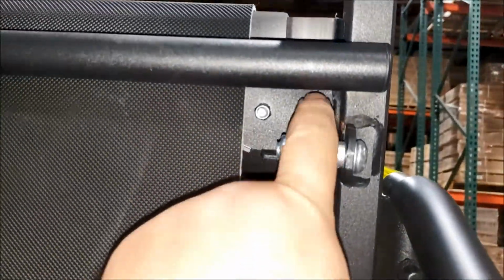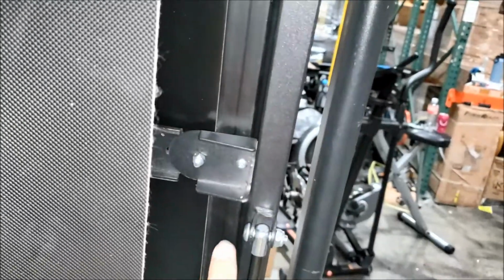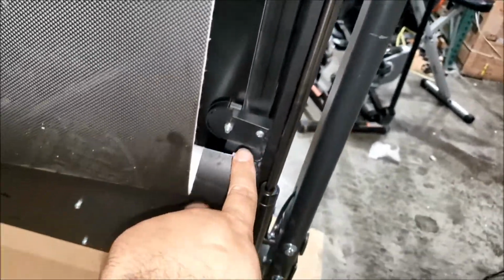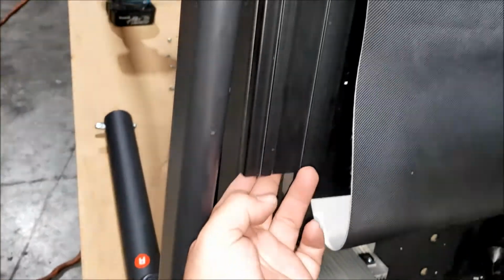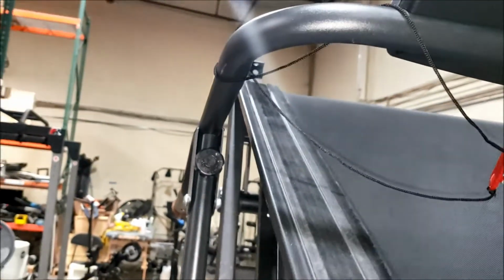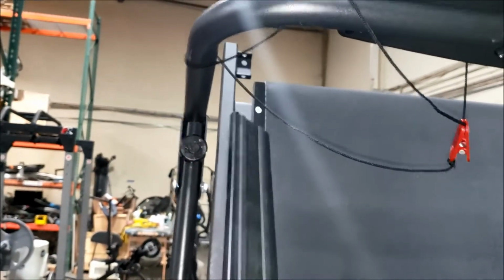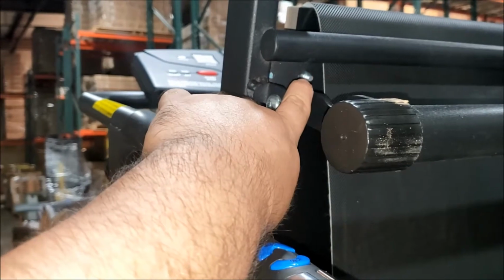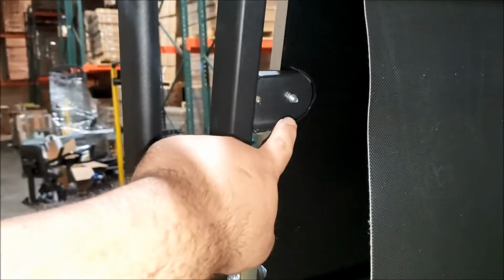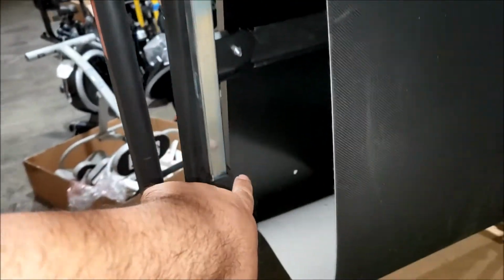Right now, the right side of the deck, the screws to remove is that one, this one, that one, and that one. Once the screws are removed, same thing, grab the rail from the bottom here, lift it up. There. And put the screws in the hole so you don't lose them. Side rails removed. We're gonna take the nuts off of that bolt, that bolt, that bolt, and that bolt down there that's holding on the deck.